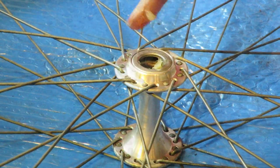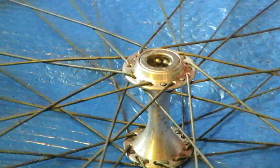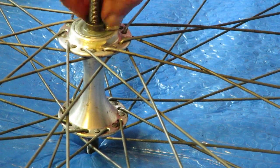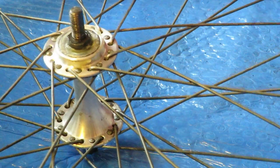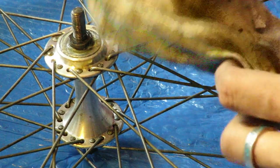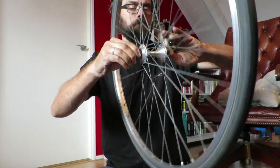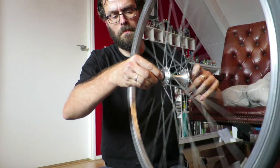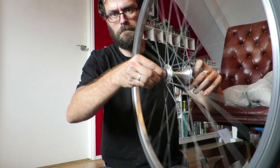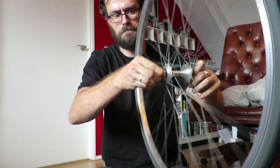And then comes the fun part, which is finding the delicate balance between finger tightening the nut enough and not binding the cone onto the bearings in such a way that it binds and that the wheel does not rotate smoothly anymore. And you do so by holding the wheel in between your hands, rotating it, and then feeling for a grinding